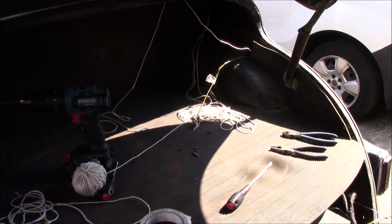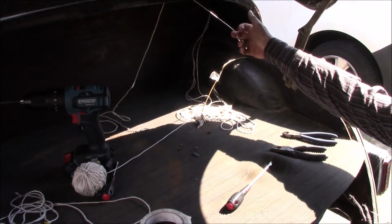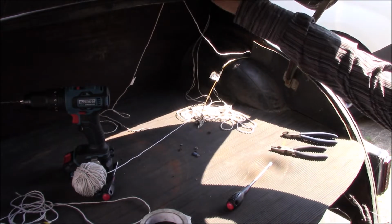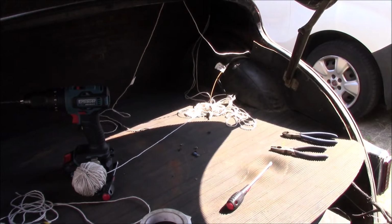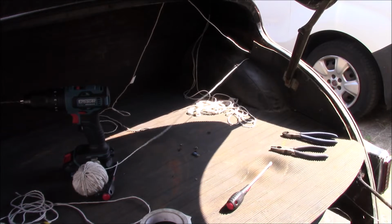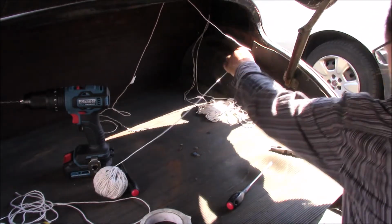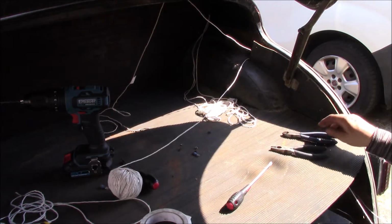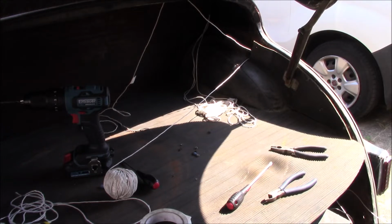I figured out what was jamming it in addition. I took out the wiring for the boot light, ran a string, labelled that up, and that's given me a lot more space for the main loom, so that's what I'm going to pull through now. There we go. Leave that string attached for now. That's another big section out.